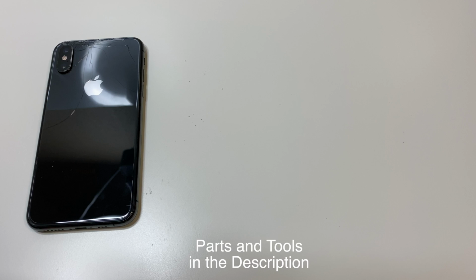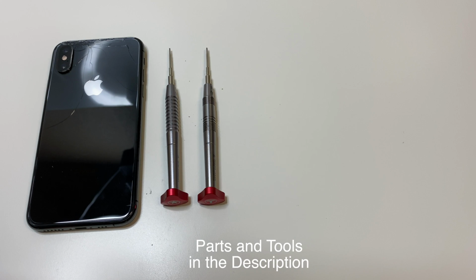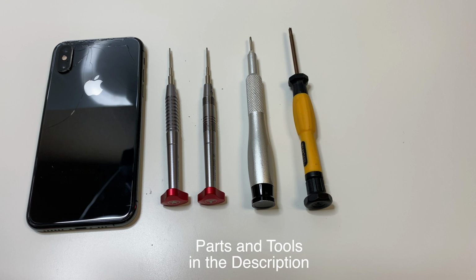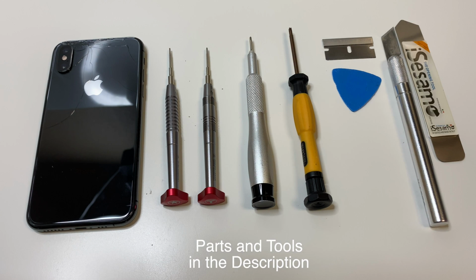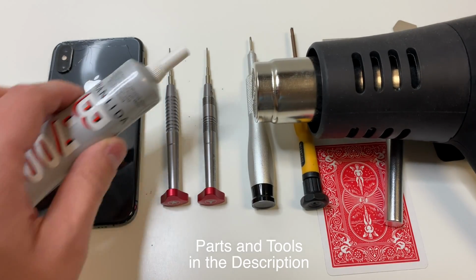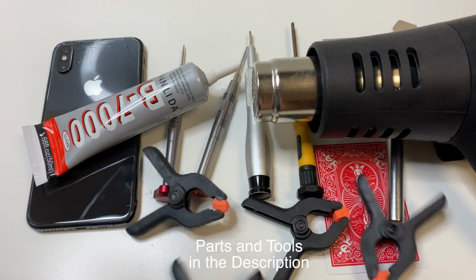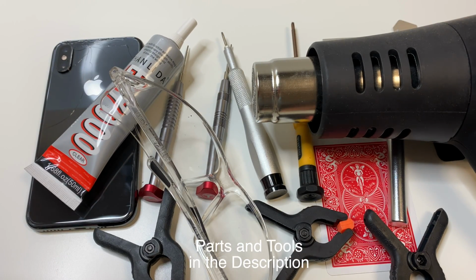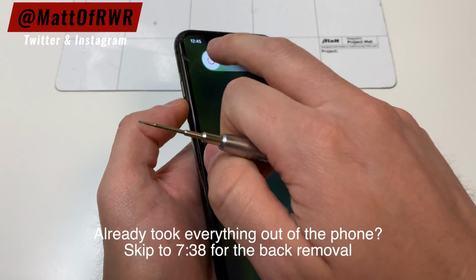So the tools you're going to need are a P2 driver, a Y000 driver, a PH000 driver, a standoff driver, a razor blade, a pick, an Xacto knife like this, a prying tool like this, and a playing card. You'll also need some heat and some glue, and you'll also need some clamps for that glue. Lastly, you want some eye protection as well as some gloves for your hands, which all of this will be in the description below.